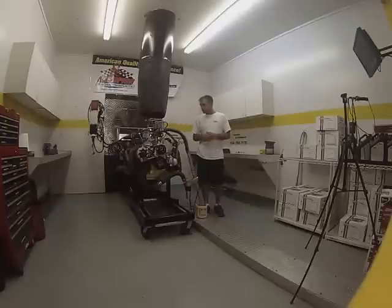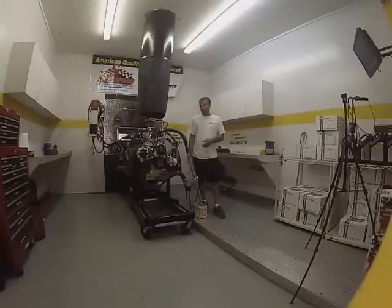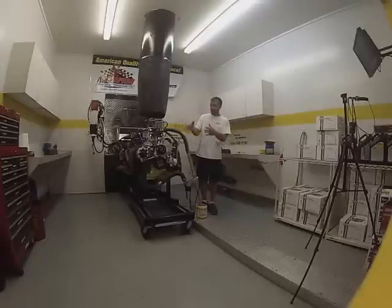And the reason for this is typically the Shelby engine would have a standard stamped steel V-belt. Well, our feeling is in today's day and age, a lot of the Cobra kit car builders and guys that are putting these cars together and or selling packages are doing Tremec transmissions, stacked fuel injection, stuff that wasn't really necessarily original to those cars anyway. So our feeling is, why cheap out on the pulley system? We don't do any V-belts here, so our plan of attack was, let's make it look like a V-belt system based on black pulleys. They would have been a black stamped steel pulley and a black bracket. So we've tried to recreate that with the March pulley system.